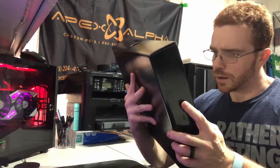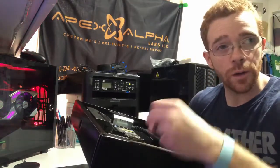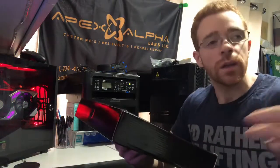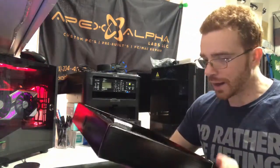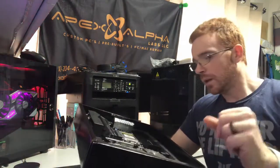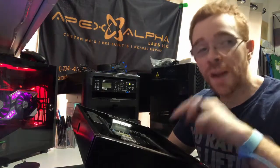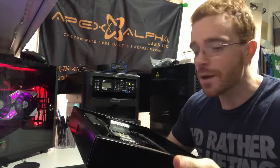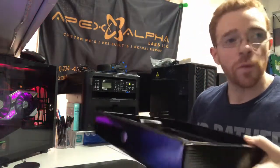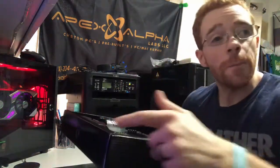It says BIOS test right here. You're always going to notice it is next to a battery. There are a whole bunch of ICs on a motherboard with eight legs, but the BIOS on ASRock boards is usually gray — a light gray that kind of matches their boards. Always look for that sticker, because you might get a board that's supposed to accept Ryzen 3000, but you've already bought a Ryzen 5800X, and what they shipped from the warehouse doesn't support 5000 series out of the box. Always take the motherboard out and check the P-number, then match it up on the manufacturer's website.